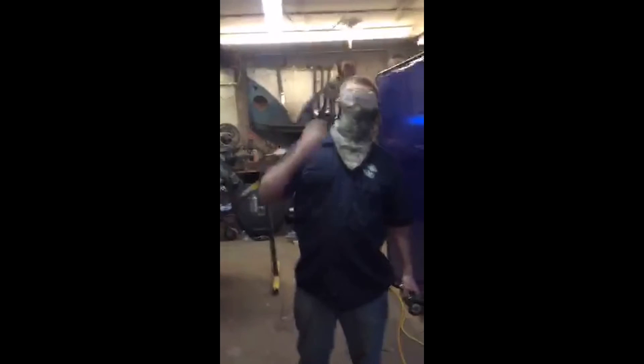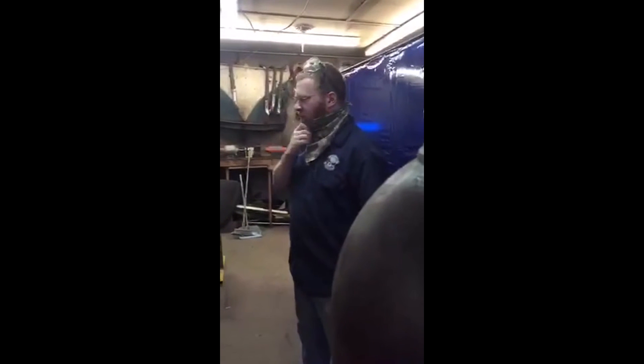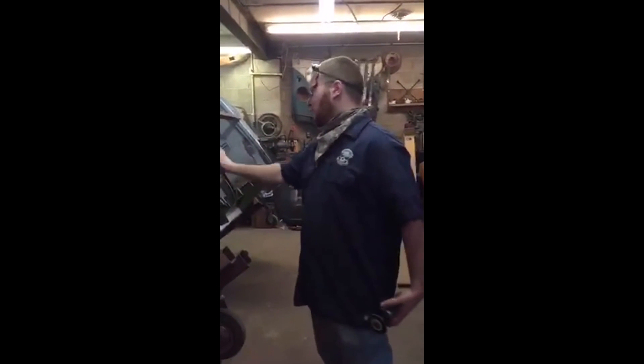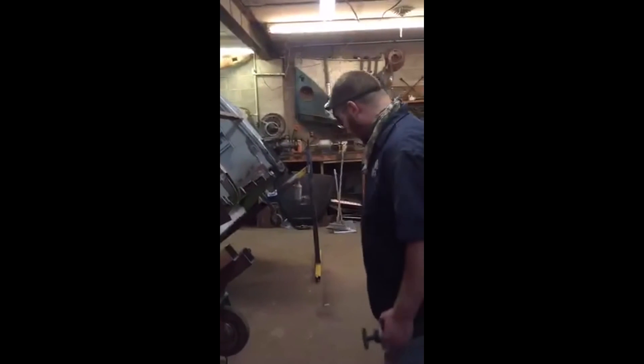What are you doing? You look like a paintbrush. That's my other job - just kidding. What are you doing? This piece in here - this is Betty Bus - it looks like that. Wow, that's bad. So you've replaced it, and I had a couple of pinholes so I went back in, welded them up, and now I'm grinding it back down. Then I'll cut it to the shape it needs to be, and eventually this will go in and it'll look like I was never there. That's the goal. Yep, very cool.